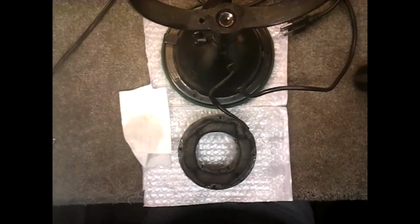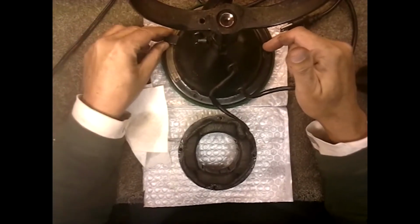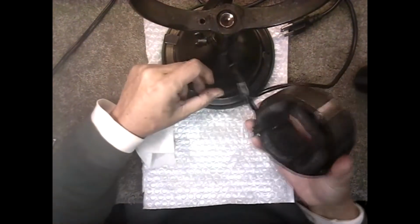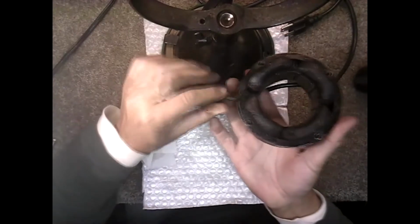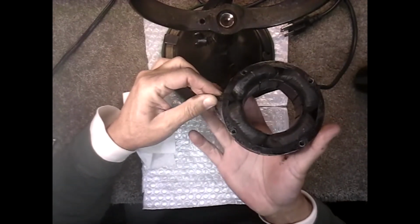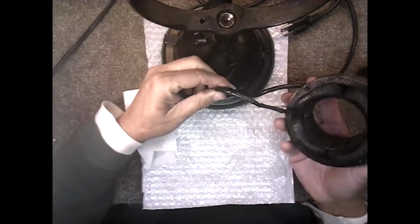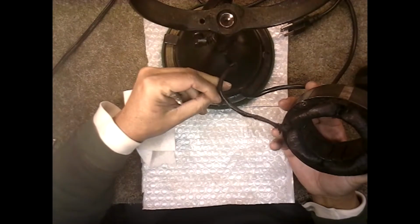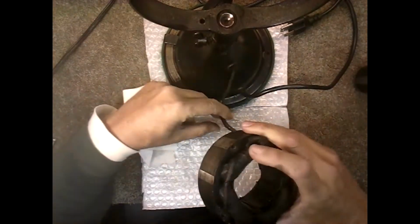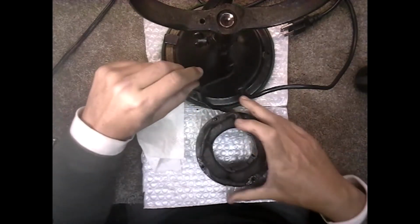Okay, Paul here, and I'm continuing to work on this GE fan. I'm about to change the head wire here. You see how corroded it is. It's a wonder it didn't short out on the armature there. The wires are actually bare and showing. And somebody did a ridiculous repair here with electrical tape. You see where it's going through the body. It's about busted off there too.